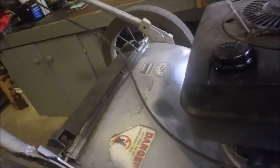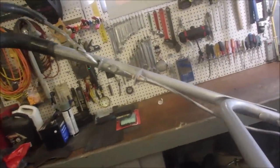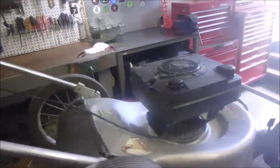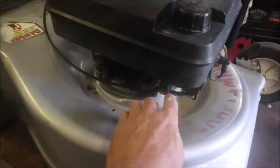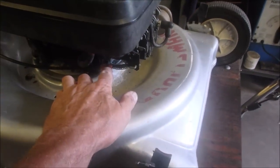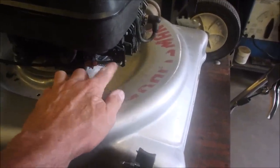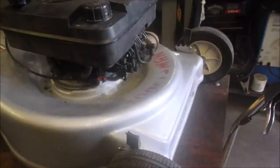This isn't right — it looks to me like the cable is seized. The on-off dead man cable is not moving very much, see that right there? I did check for spark and there was no spark. So I've got a hunch if we disconnect this dead man cable and put a tie wrap on here just to emulate that, we'll get a spark. Let me get on that.